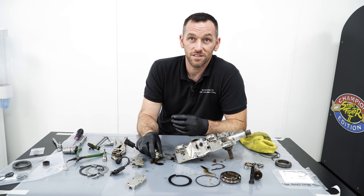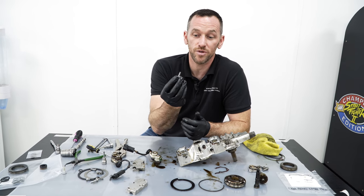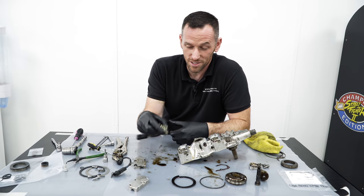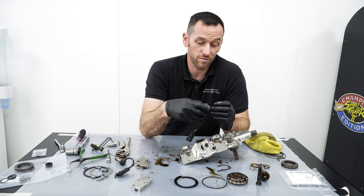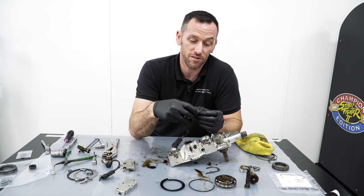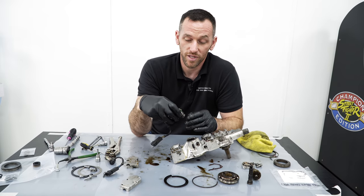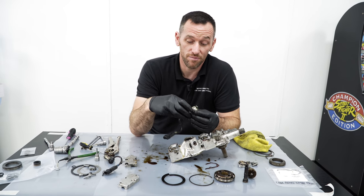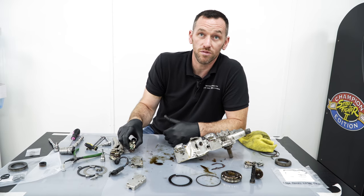Well, it's like we were saying, like 120 bar pressure. Yeah, it doesn't take much pressure to snap a little tiny M6 bolt. So the trick is to fix the problem of the seals being too small from the factory, and we make a D-ring, which is a perfect fit for the groove. It's slightly oversized in its diameter for the bore, and it just means it can't twist. And then by doing that with an even stronger bolt, it eliminates the problem for good, basically.